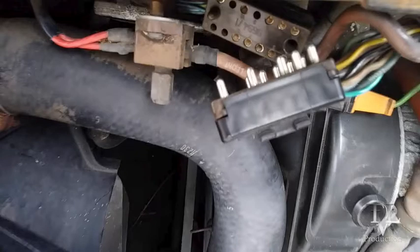While I'm over here, let me just point out a couple of things. These three wires send power directly to the CE panel, and they get their power from this wire right here — this wire comes directly from the alternator and it's carrying 12 volts all the time. Because of that, this post right here is always live and should be covered. When I bought my car, it was not covered, but I may just put a piece of tape over it to keep from accidentally hitting it with a screwdriver.